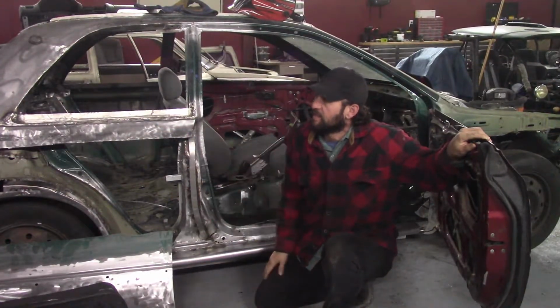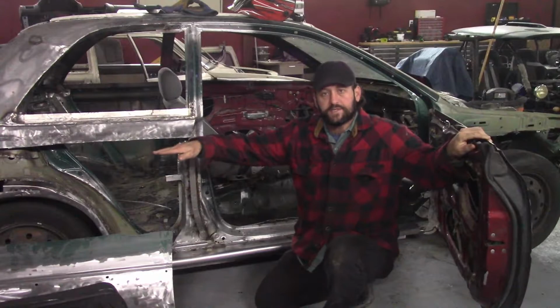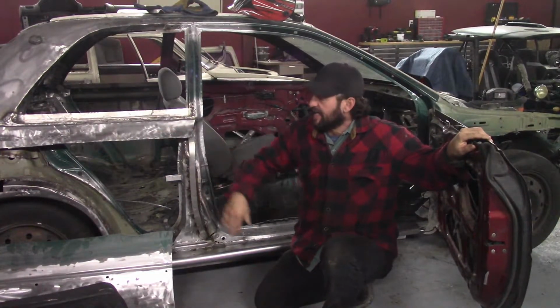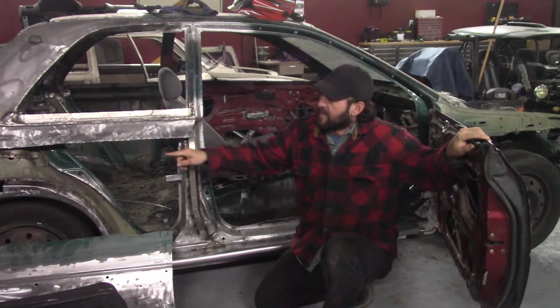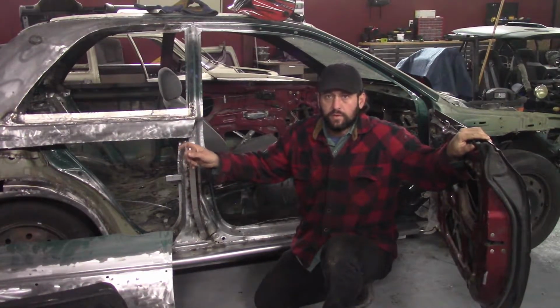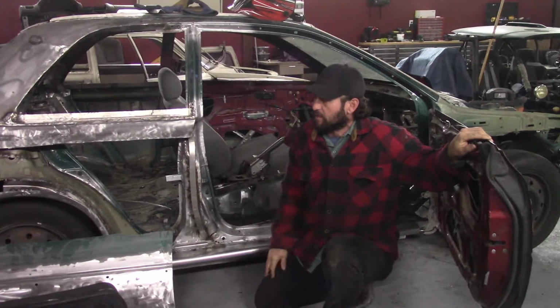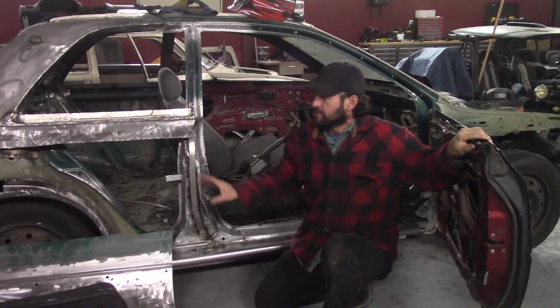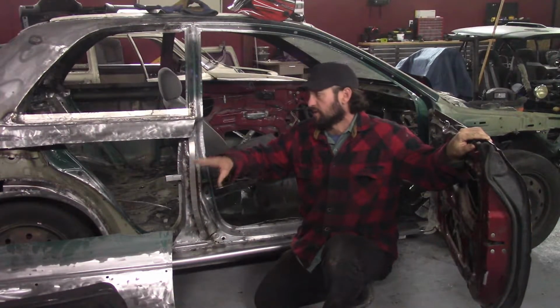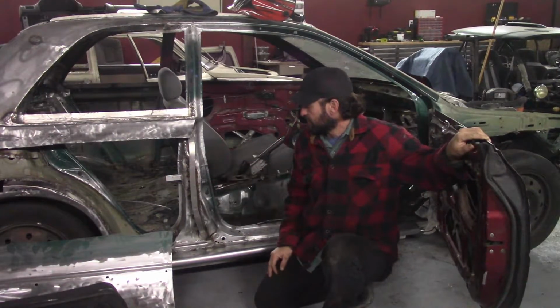I cut the support for the C-pillar, moved the original wheel tub up by hitting it with a big hammer repeatedly, welded the support back, added a new 22 gauge wheel tub, and am reusing the original fender arch so that I have the exact same look. I did it the same way on the driver's side, now I'm doing the passenger side.